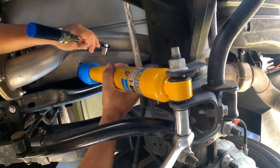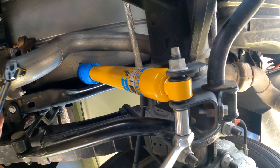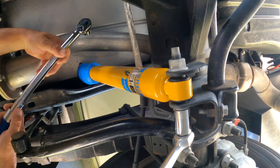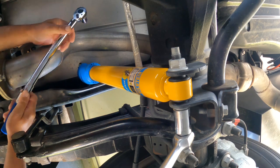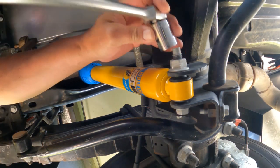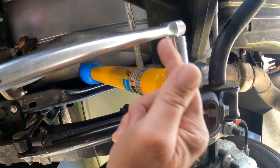It's not really a whole lot. Actually, it's not crucial to torque these bolts because the load is on the side. It's not a compressive load. But it's still a good idea to torque them, just to be safe. Because there again, the load is here, not here.